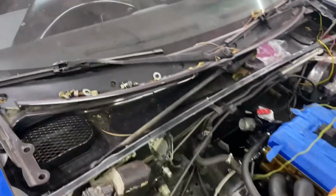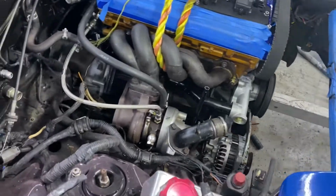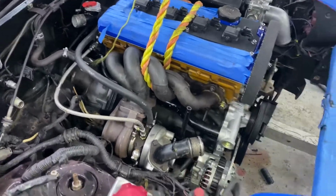And the same thing with the transmission, the shifter point, it's like a foot away. So once this goes back, the shifter should align close enough, and then hopefully this works. Not a huge issue. I mean, it sucks, but I have to take the whole turbo out after I put all the lines and everything. So I've got to take the turbo out, take the housing out, and then try to wiggle the engine down a little bit more. But look, it's looking good though.